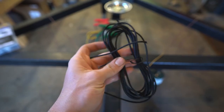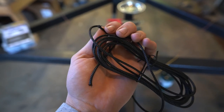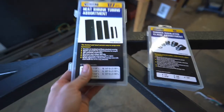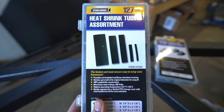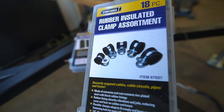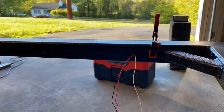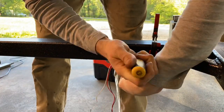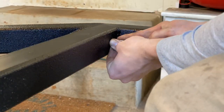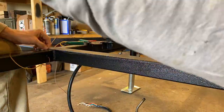Before making any connections, I'm going to sheathe the wire in a plastic braided sleeve — I'll link that in the description — as an extra protective coating that also looks nice. I've also got some assorted heat shrink from Harbor Freight. There are clips I'm using with self-tapping screws to secure the harness to the frame itself. I'm also going around to all the holes we drilled in the frame and putting rubber grommets in them — you can get those at Harbor Freight as well, in a package similar to the hose clamps and heat shrink.